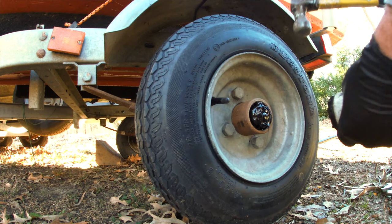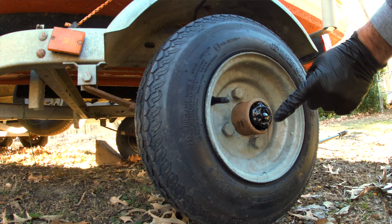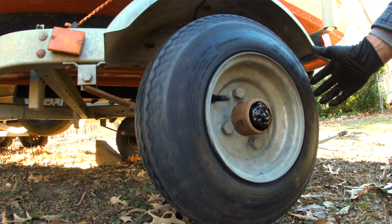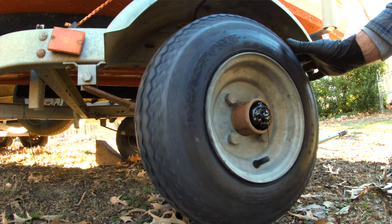I'm taking a look at this grease and it's black and goopy and drippy looking. The really good thing is it's not milky and it's not super watery. It's grease and there's plenty of it in there, but it is a bit thin — this is in the dead of winter and it hasn't been driven anywhere in a while. I'm giving the rim a good spin to see how this wheel spins, which will tell me a lot about how these bearings are — whether there's any noise, grinding, rattly sounds, or squeaking. With mine, I'm not hearing anything like that and it's rolling very freely both directions. That's a really good sign that my bearings are not dry, rusted, or completely shot.